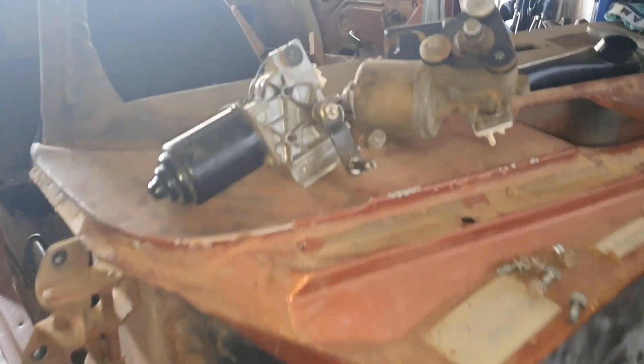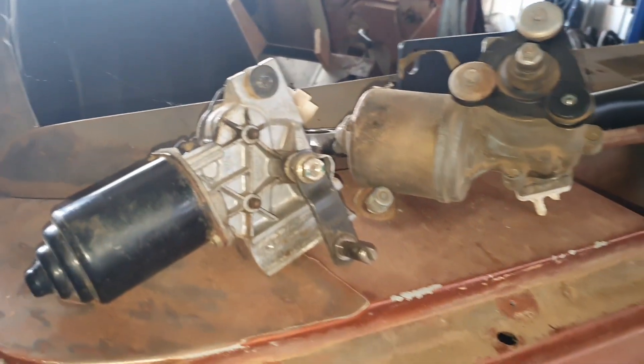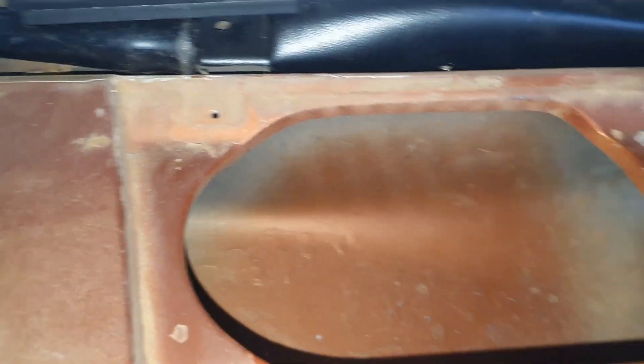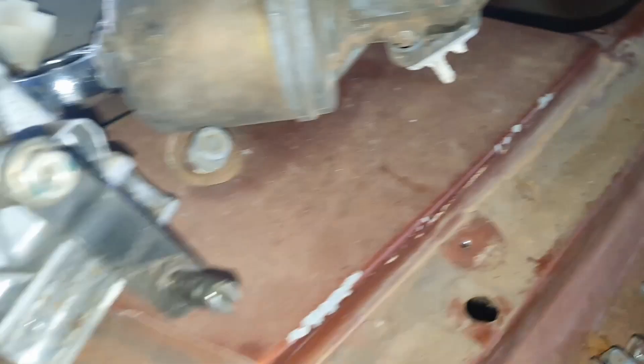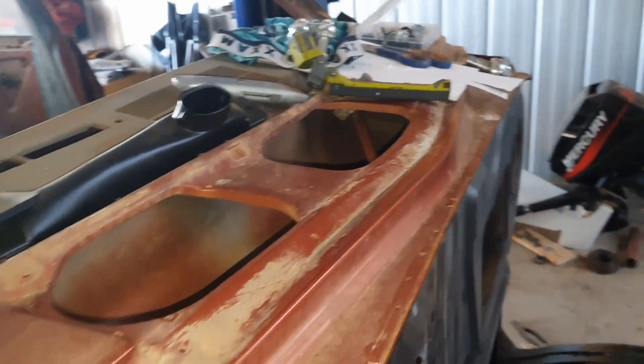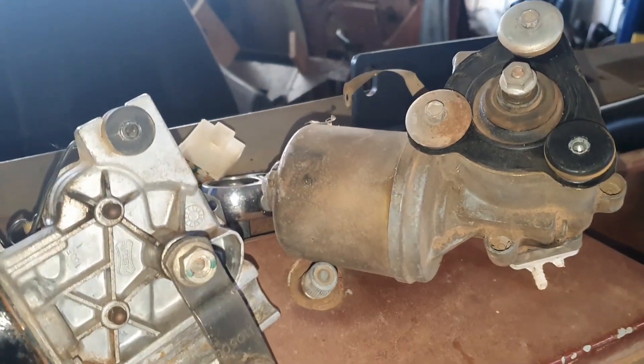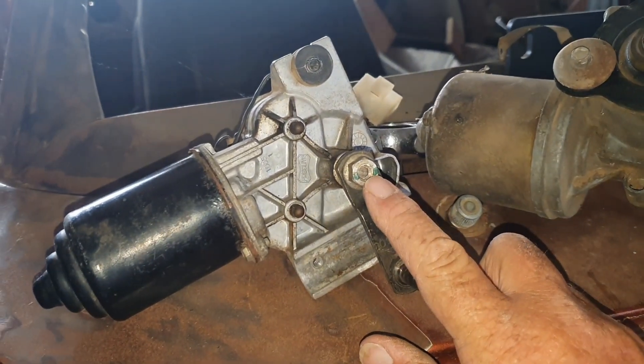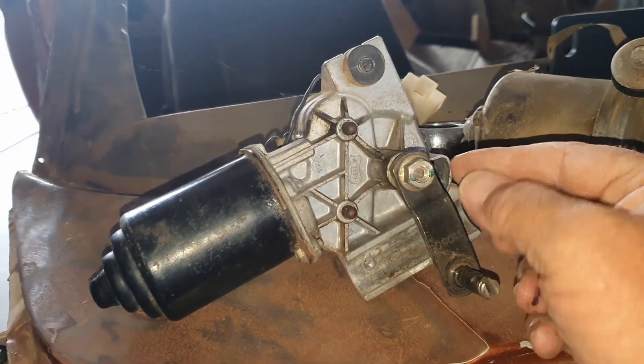There's your two wiper motors. The HJ sits on the outside, the VT will sit down in there. I've seen a lot of people cut all the plenum out so it sits in nice and neatly, and they're having trouble with their wiper arms — the whole box and dice. So what I've done straight up is taken the wiper arm off the HJ and fitted it to the VT.